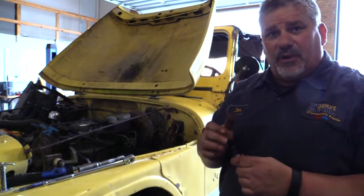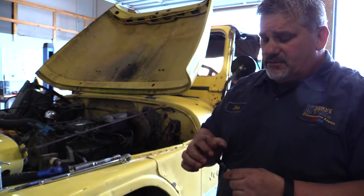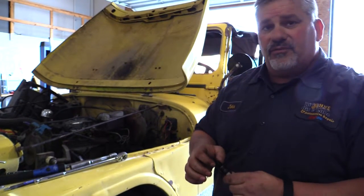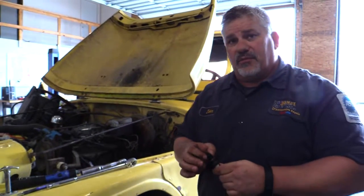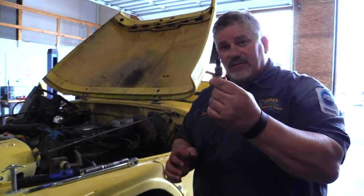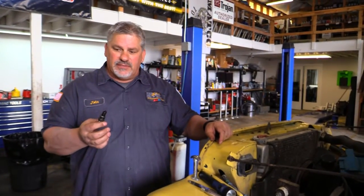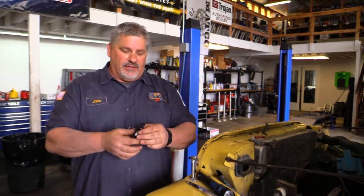the spark plug itself. A lot of times you'll see a brownish type of black there, that's the kind of good burn that you really want. You don't really want this thing to be that black. So one of the aspects of changing out your spark plugs is that you're keeping the efficiency of the electrode that's in this going. And not only that, it also tells you what's going on in your vehicle.